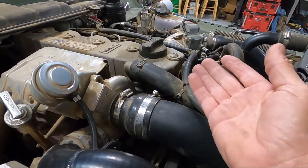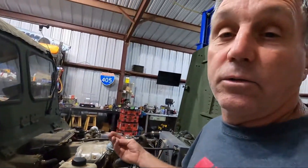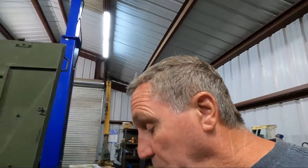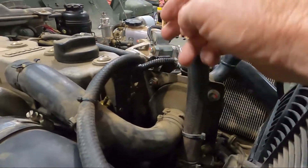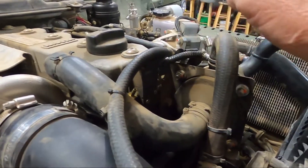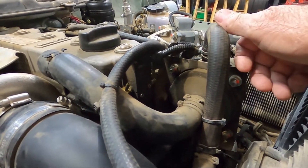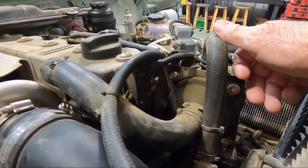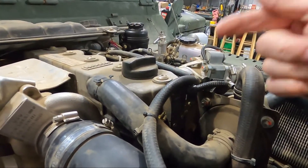Maybe when you come off the throttle or between shifts they want to drop the boost so you don't have a bunch of boost build up in your intake — kind of like when you have a car with a manual transmission. I've got a Ford Focus ST — whenever you let off the throttle you hear the wastegate open and let boost out. That's what that controller is doing. Since I don't have the stock transmission computer anymore, this wire goes to nothing, just to the end of the cannon plug. That is why my engine was smoking — I was just getting full boost all the time.